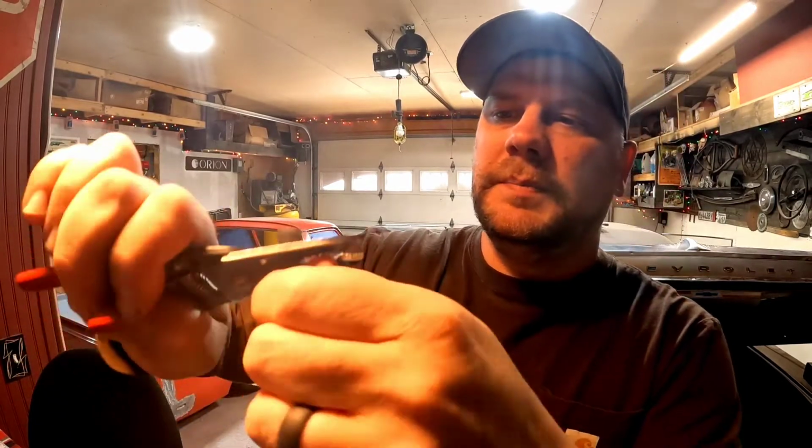Alright, we got our power wire, RCAs, speaker wires, and a remote wire back here. We're just missing a ground. Considering the amp is going there and the battery is right here, I think we'll just go right to the battery. Got some 4-gauge ground wire here. Give her a strip. Earlier we used that hydraulic crimper. We're going to use a different method this time.